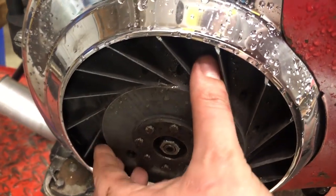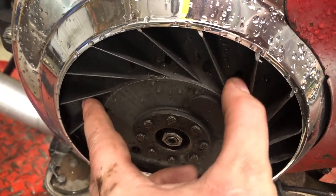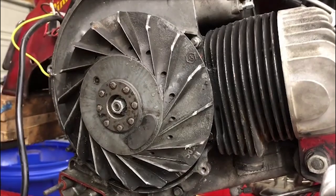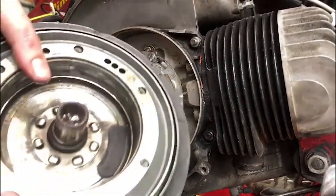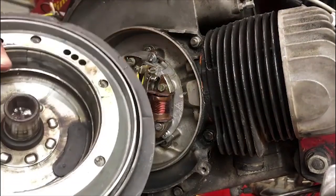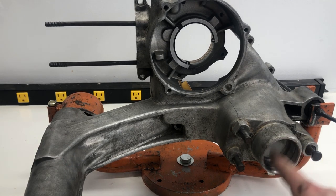So eventually the bike ended up in my garage, and surely enough the flywheel was completely loose. This is the new flywheel puller. As it turned out, the flywheel broke the crankshaft taper. We're blaming two things on that: short gearing and an old, worn-out flywheel. So I took the engine completely apart and it's time to do a full modernized rebuild of this engine, which is a Sprint Veloce engine.